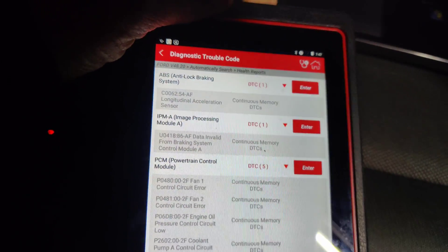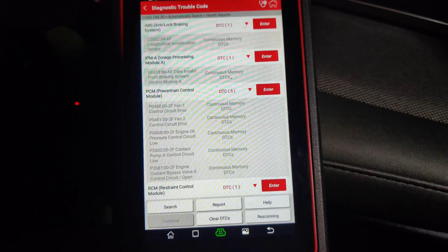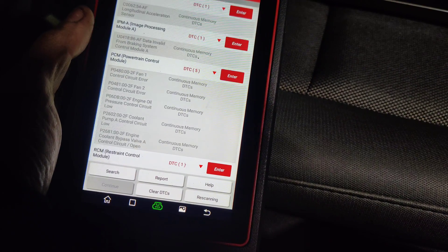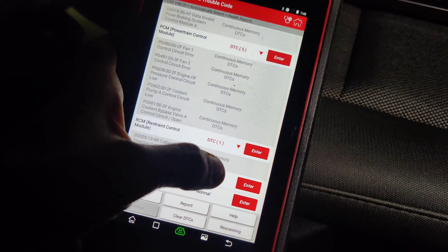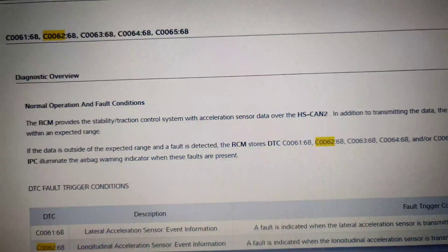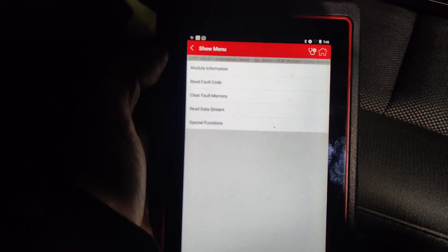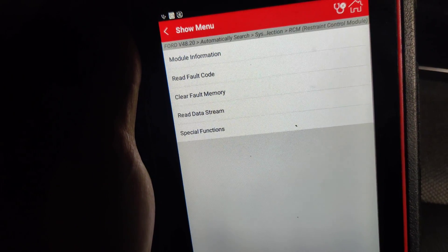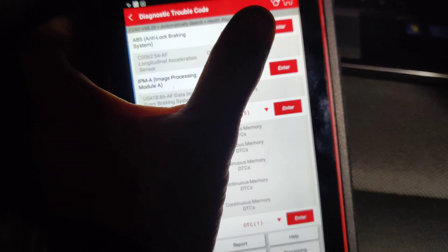Still says longitudinal sensor. I wonder if this is just wrong. Let's see if the code stores. So the RCM does — maybe that's why I couldn't see it, because it comes from the RCM. It says right here in repair information, although I can't find any information on the code that we have because ours ends in 54. Let's see special functions — is it the RCM that has it or is it the ABS module? Let's go in the ABS module.